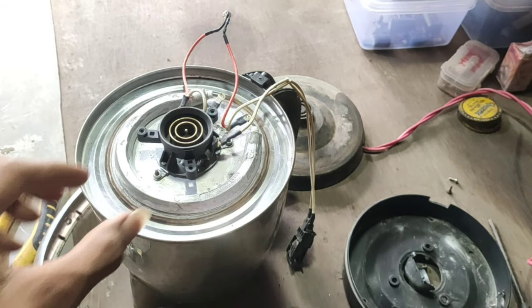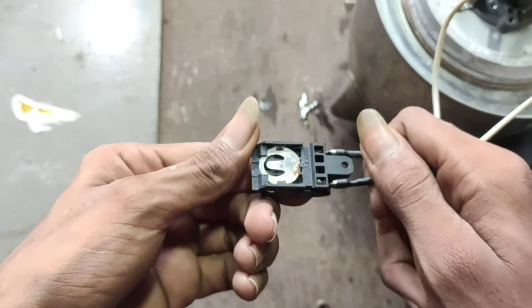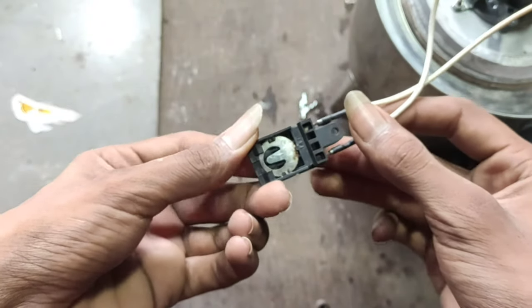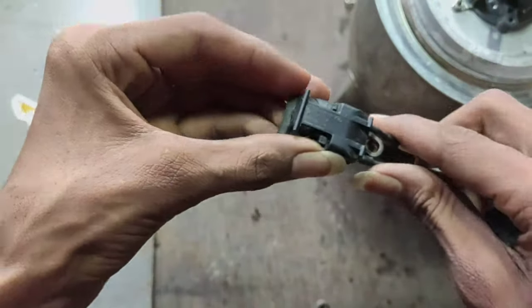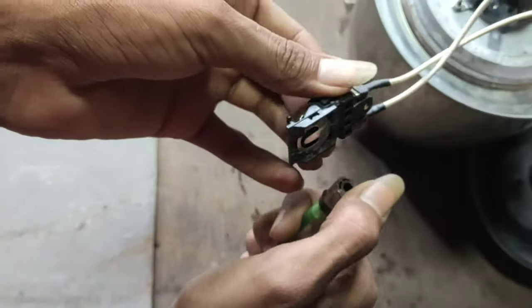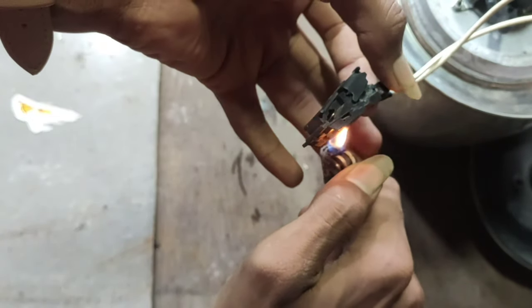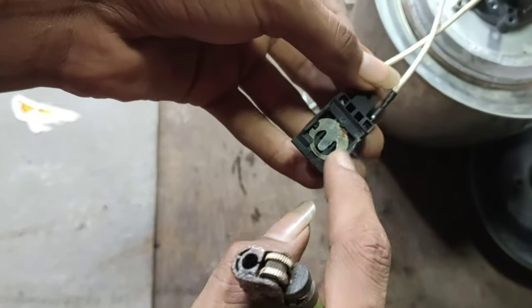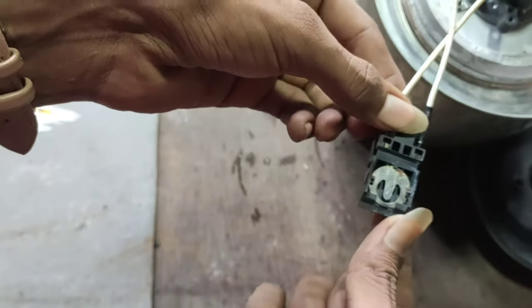After scratching my head for some time, I think I finally solved the mystery. The actual magic happens not at the front of the switch but at the back of it. This metal piece here does all the magic — turning the switch off whenever water boils. I turned the switch on manually and let's see if it turns off if I hit that metal piece with a lighter. And yes, it does! This piece is pushing against the switch and does not allow the switch to stay in the on position until the metal is cooled down.